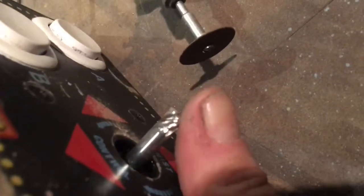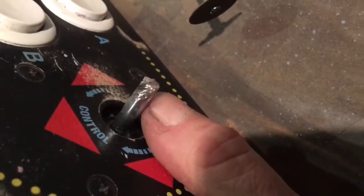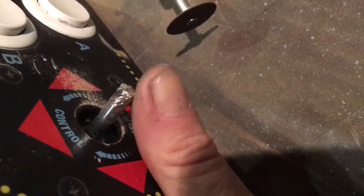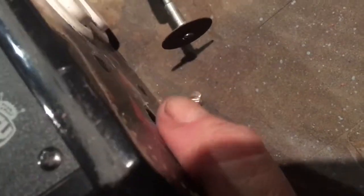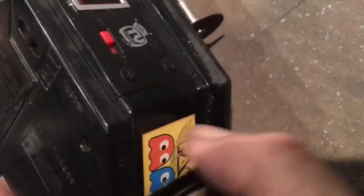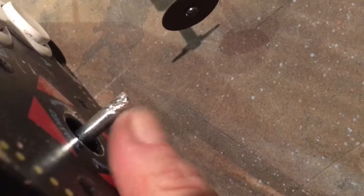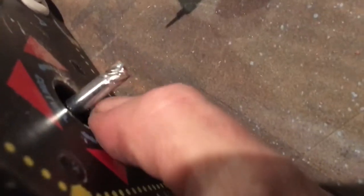Once you put epoxy in the hole of that wood, the epoxy will soak into the wood a little bit and expand the grain of the wood. At the same time, it'll go down in between the ridges that you've created, and it'll dry in there like a hard plastic, so it'll act to keep the wheel stable.